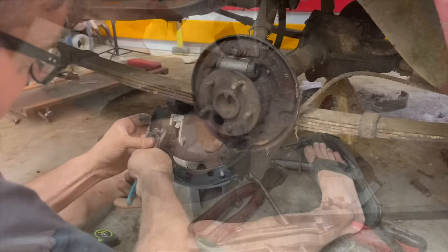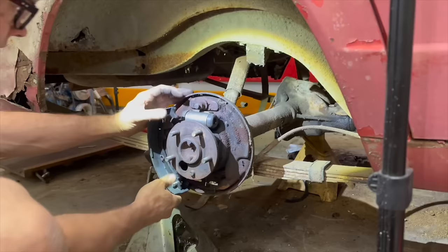Putting our emergency brake arm back on here. I've been known to leave the emergency brake off a time or two in my life. This little spring-loaded booger back here behind the emergency brake arm is not easy. There we go. Had to get my long needle-nose pliers for it. And remember, brake shoes are just like school pictures. The tall one goes in the back.